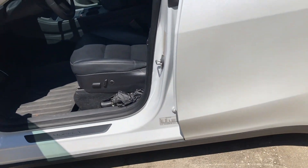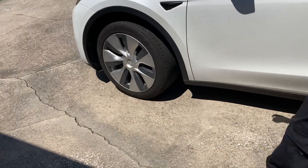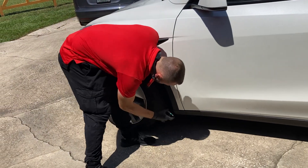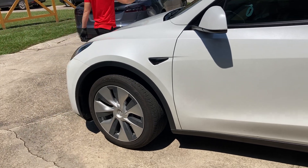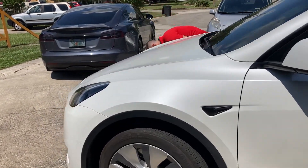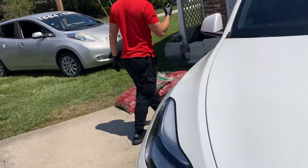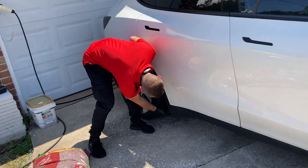We've got new tires for the back, I think. Your rears are running low — you're at about 3.5/32nds, 4/32nds. Your fronts are almost there; you've got 9/32nds. Yeah, I wouldn't even do a rotation at this point, I'll just replace the rear. This one is almost gone — about 2/32nds.